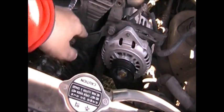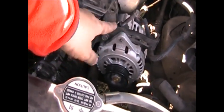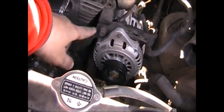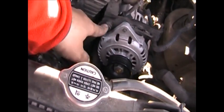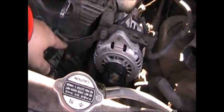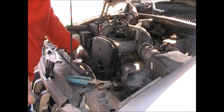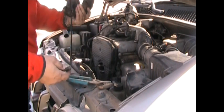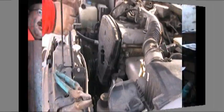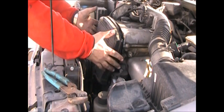I'm going to take this guy off next — this will loosen up the alternator bracket, but it'll just hang kind of loose there. Then I'll remove these two. This looks like a 14mm; these are a 12mm; that bolt is a 17mm. This part is held in by three bolts that are all 17mm. Now this thing has five bolts holding it on.